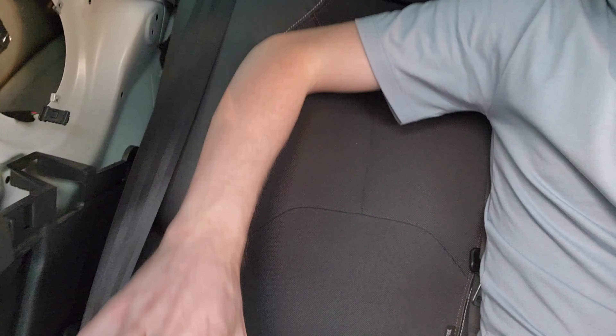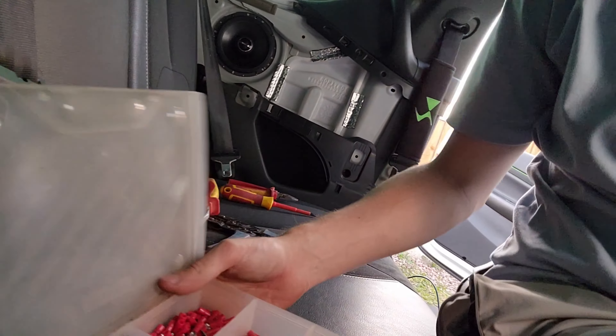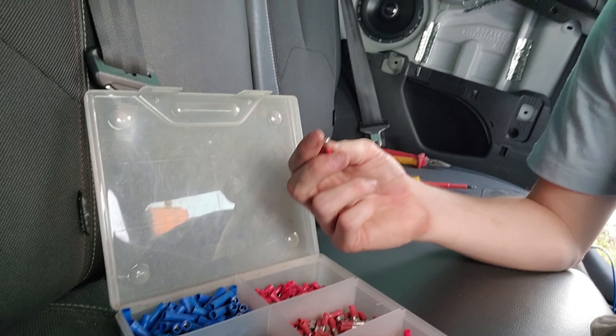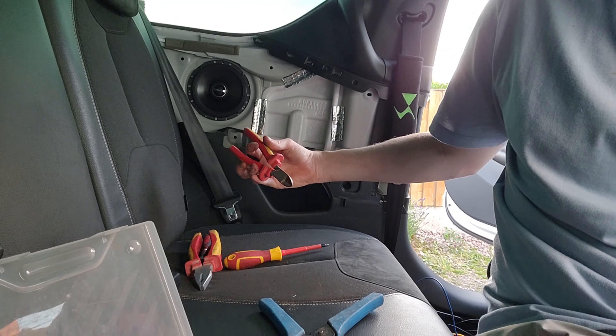This is the aftermarket speaker I've got - Alpine S65s. They're good but don't have a huge amount of bass, which is why I'm adding the under-seat sub. The front speakers I believe are Pioneers - I can leave a link in the description. With this wiring, my intention is to splice these wires and use spade connectors - I think they're called spade connectors. This way I can unplug and plug them in again in the future without having to cut the original wiring harness. I'd just recommend them. You'll also need a set of crimps and wire cutters.